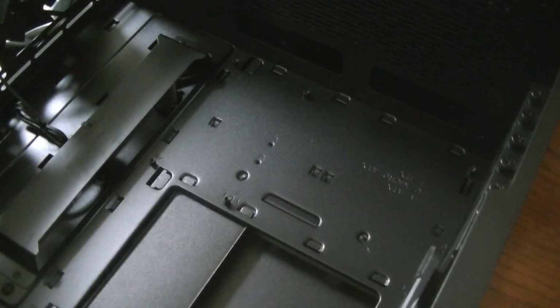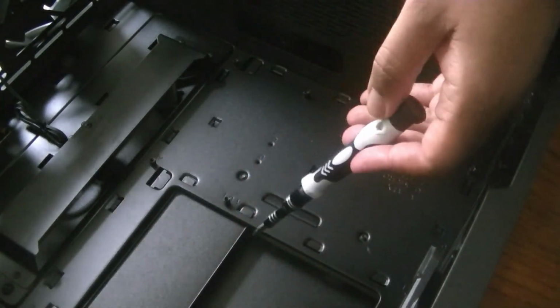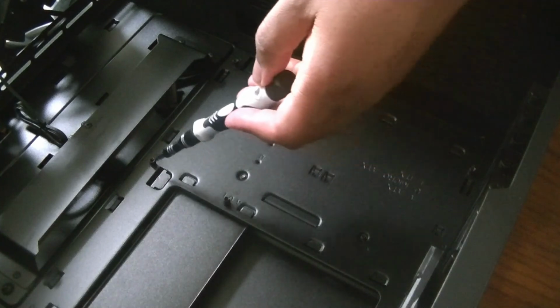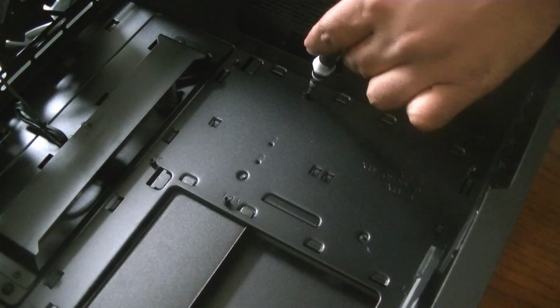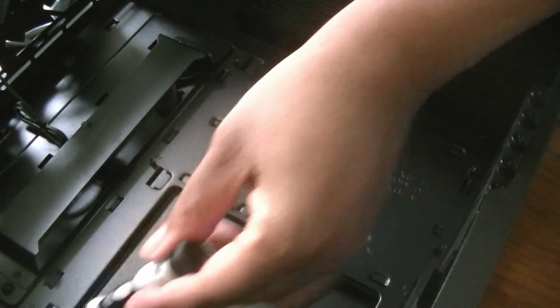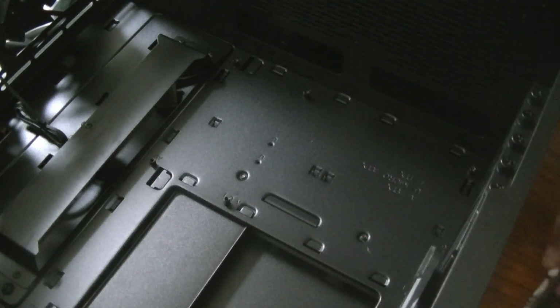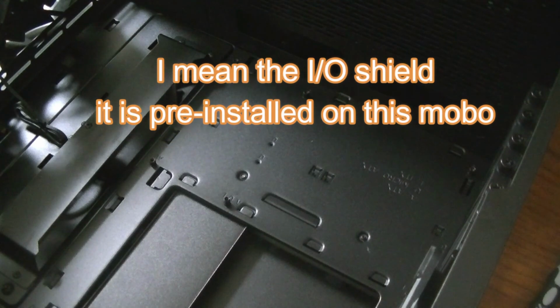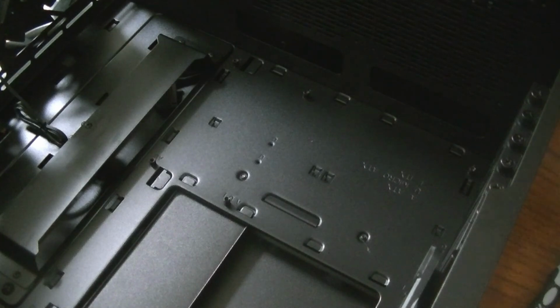So now we're back and we're about to install the motherboard. We're double checking what's there. We have these areas here. Let me show you, for example, these points, which will be points where the motherboard will be installed into. And so we're just double checking and making sure that we can put these things in there. Of course, we're also installing, you can't see it here, but we're going to put in the I/O shield, which has all the different ports, LAN cable ports and things like that, in the back of the computer. So we're going to take these and see if we can do it.